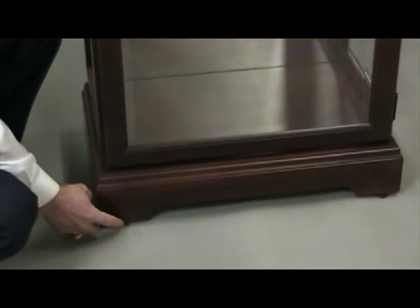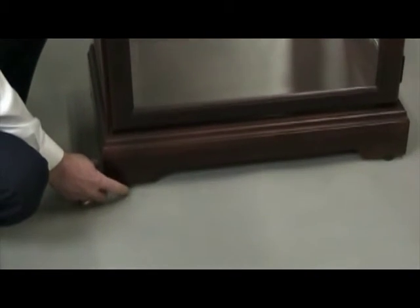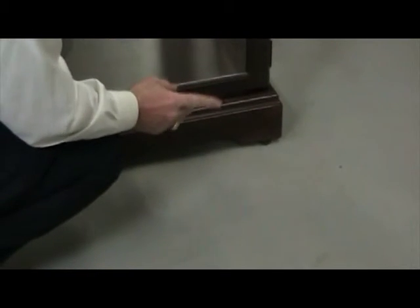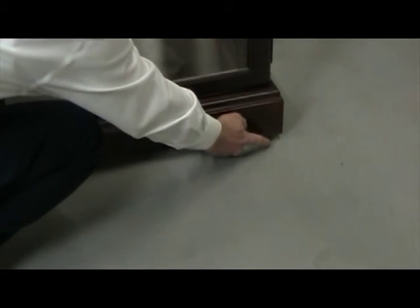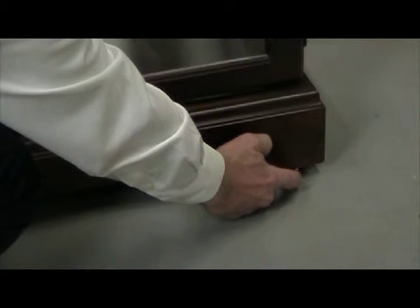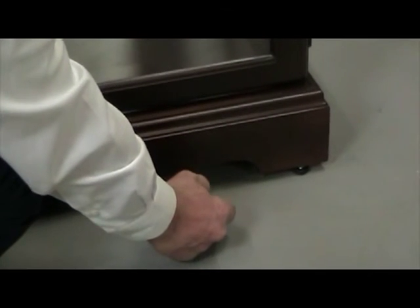If it is resolved, what you want to do is lower the other levelers so they're just snug to the floor. If that did not adjust the level of the door, repeat the same process: slightly tip the cabinet back, lower the hinge side leveler such that it releases the lock side lever from the floor, then assess your gap and snug the other three levelers to the floor.